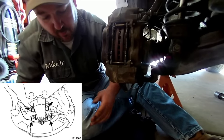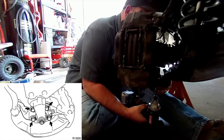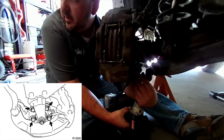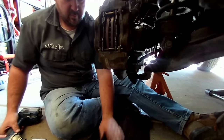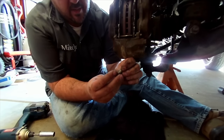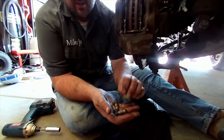I had to knock it up to get it set in there real good. I'll go ahead and bust them all loose with a ratchet, then use a little impact with a six-point socket to run them out. We've got new bolts to put back in - you can see these are really rusted and rounded off, someone's been in there before and really jacked on them. When we do ball joints we always like to put new bolts in. The bolts from Toyota for this are like $1.20 a piece - cheap insurance. Put the old ones in a Ziploc bag and throw them in the back of your truck for trail spares.